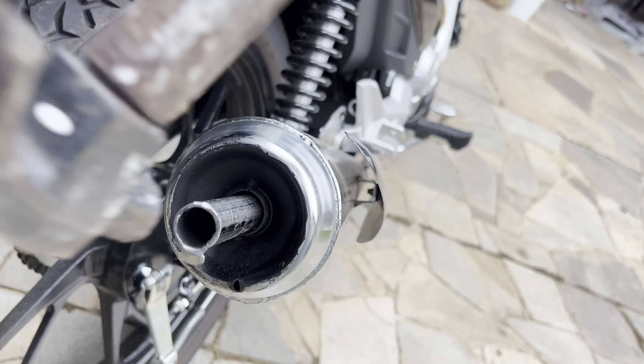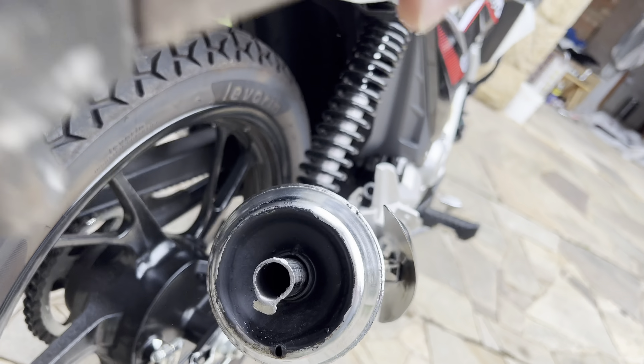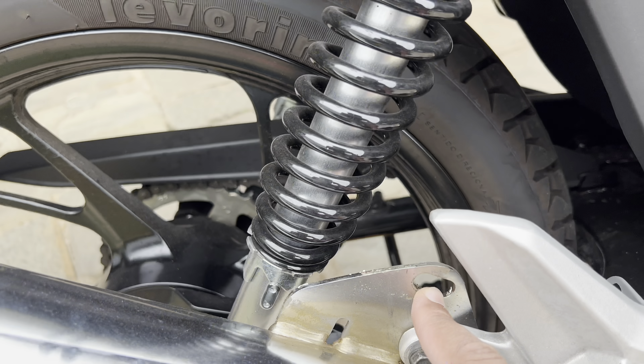Let me give it a little tap to see if it goes. There it is! He put a small stop on it so it doesn't go all the way inside. Mine went in tighter than his, but I think I know why — you can see I raised the exhaust, so the hole ends up here and since I raised it there's a slight bend, which is probably why it was hard. But it went in. Now let's hear the sound. You'll ask what the diameter is — it's about 1.5 centimeters diameter on this little pipe.